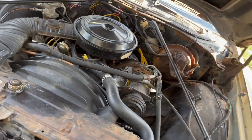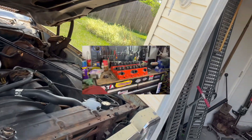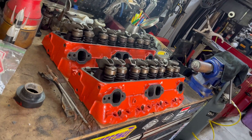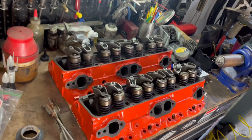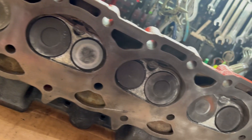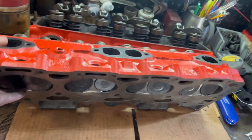But since this has crappy 8:1 compression and I got another set of cylinder heads for really cheap — these 305 high output, 53–54 cc's — they have brand new valve seals on them too. I did some polishing and shaping on the bowls on all of these, so they're closer to 55 cc's, which is fine. That's going to help our cause of keeping it at or a little under 10:1.